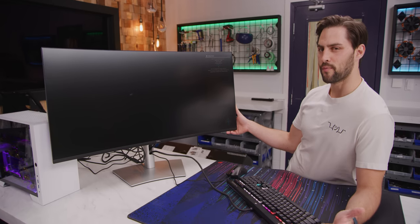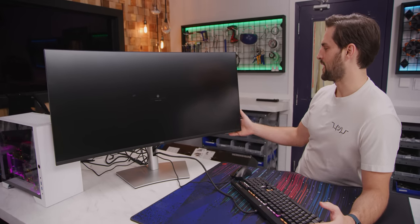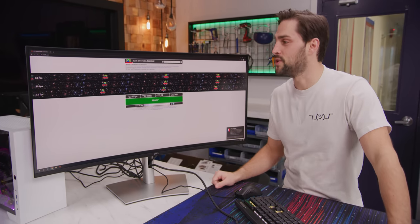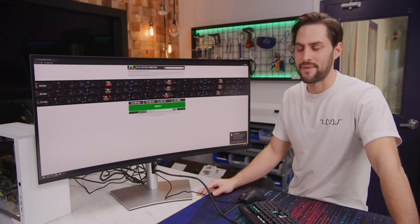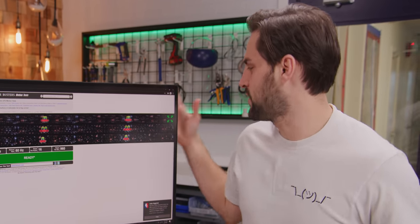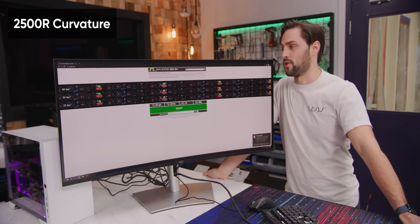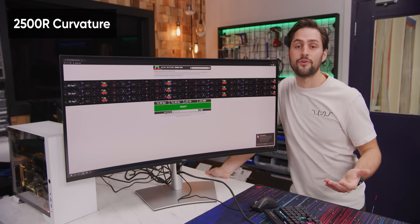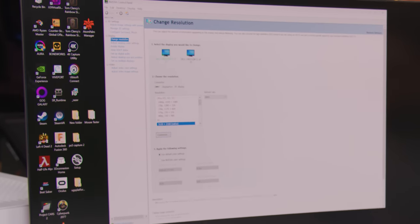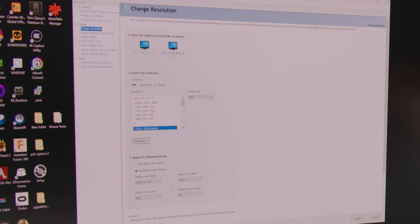This is like a little tutorial teaching you how to use the OSD and some initial setup, kind of like what you do on a TV but you don't normally do on a monitor. The first option I have here is to enable always-on USB-C charging, other USB charging, and uniformity compensation — all of which will increase power consumption. If you wanted to adhere to the energy star rating that it has, you have to keep those off. This is not really a gaming monitor — it's a 60Hz monitor. They do claim to have a five millisecond pixel response time as this is an IPS panel, but for that you need to put it into its fast mode, which means you might get some overdrive. It does have a matte kind of finish, 3H hardness. It's curved with a 2500R curvature, which is not a very aggressive curve — other more gamer-oriented monitors will have 1800R or 1000R. In the NVIDIA control panel, the native resolution is 5120 by 2160 and I believe this is a true 10-bit panel — no FRC malarkey.